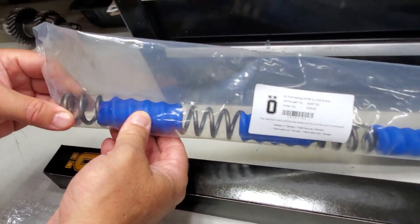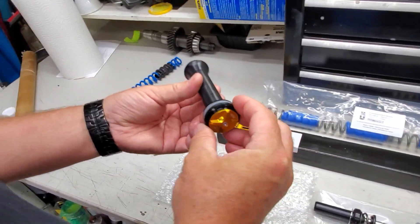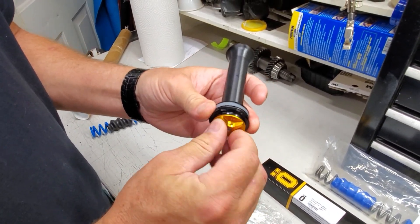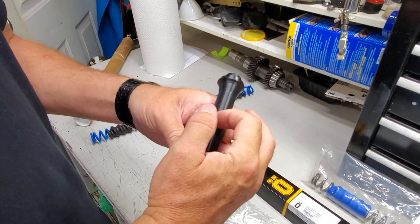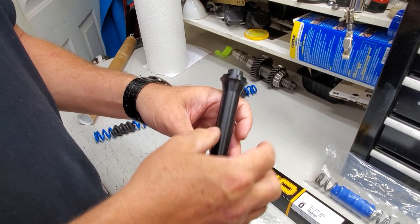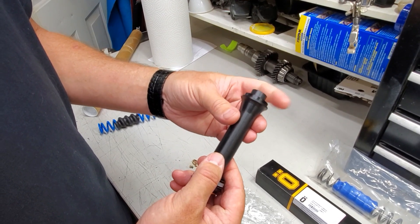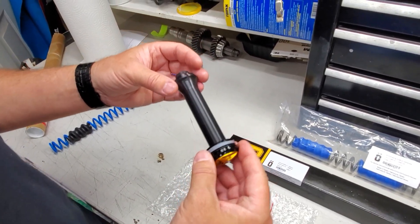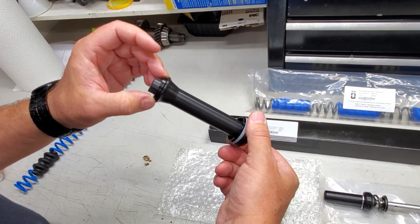...heat shrink, which is a nice touch. Looking at the adjuster, this is for setting preload on the shock. As you click through, the entire shaft moves down. This is an anodized aluminum piece — not plastic — which is a really nice touch. They also put a piece at the top that allows the shock to spin should it get into bind, which is a nice plus.